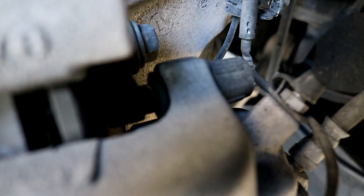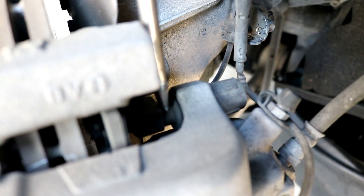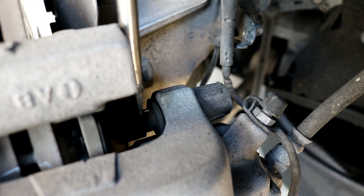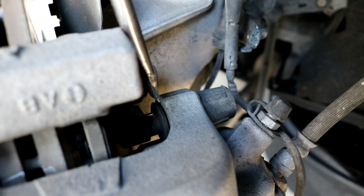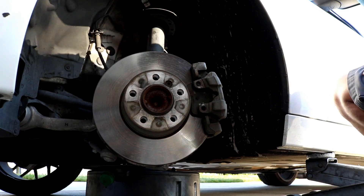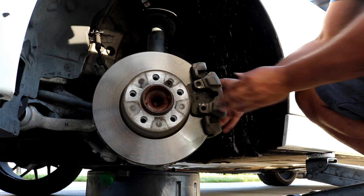After you get those caps off, those are the two 8 millimeter bolts you need to take out. You'll notice when you're loosening the bolts that you'll start to see threads from the screw right here. Once you've loosened up the screw, get your flathead in here and pry it a little bit — trust me you're not going to damage it at all. Just pry it this way; that enables you to get the caliper off a little bit easier.